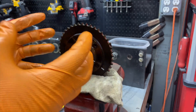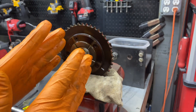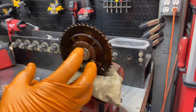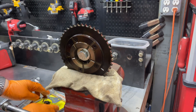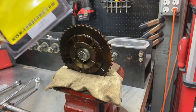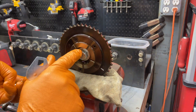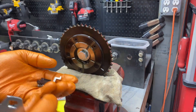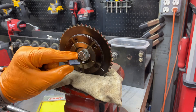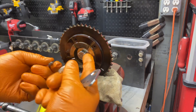To make that change, we're going to lock it down from about 50 degrees of adjustment down to maybe 20 degrees, using this little block-off plate. The Comp Cams phaser kit — product number 5456 — comes with this tool, the block-off bolt to keep the phaser from coming apart, a temporary lock tool, and the permanent phaser block that we'll slide in, plus a Torx bit to remove the Torx bolts.